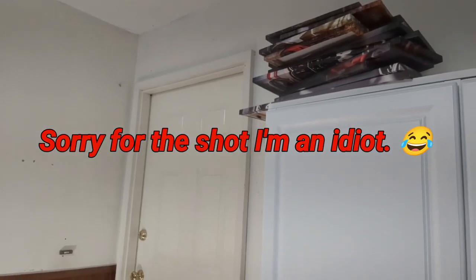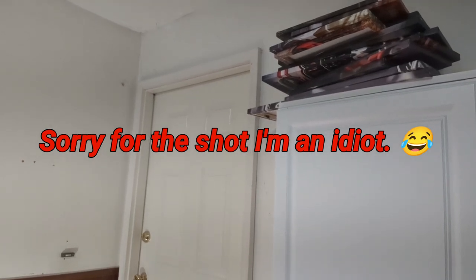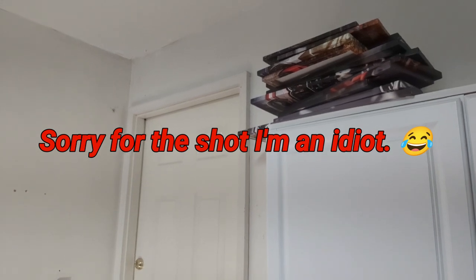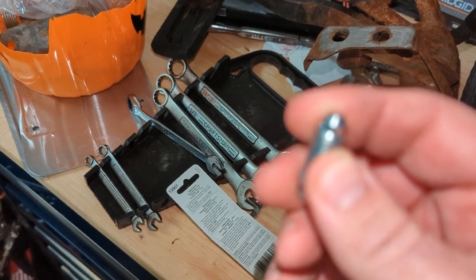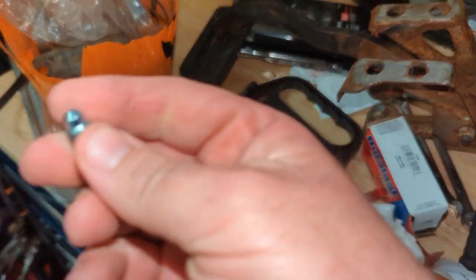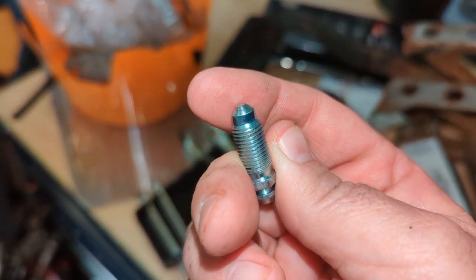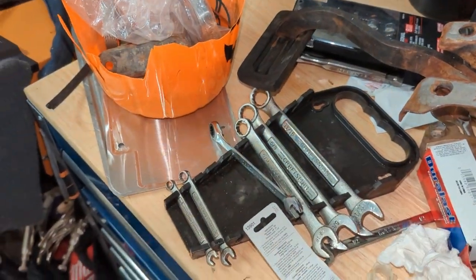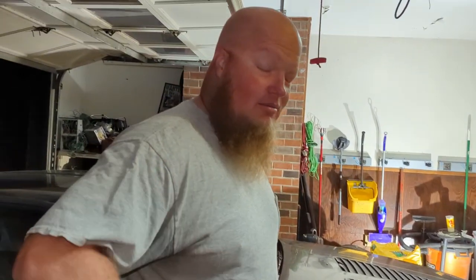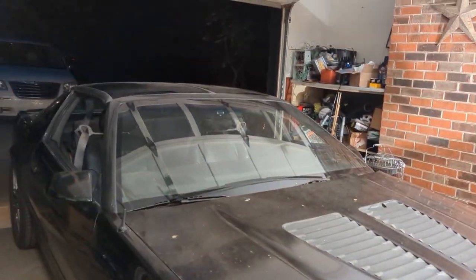It's still Memorial Day — I shouldn't be doing this because it's my wife's birthday — but my buddy Josie is here and he's going to help me bleed this clutch. He's also going on Power Tour with me, so you'll be seeing a lot of him. I got under there to bleed it with a remote bleeder and it was dripping — it had a scar on the inside of the mating surface. Went and got another one at AutoZone at 8:40 at night. Got it installed, bled — no more leaks. He's already pushed me out of a parking place or two.